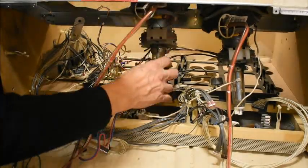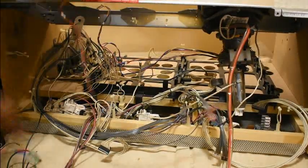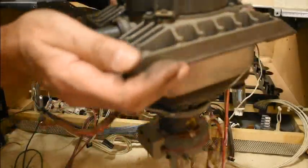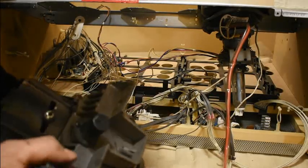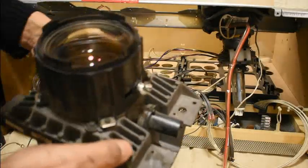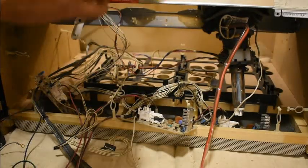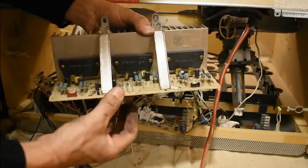The centre CRT is now freed up — that's the green CRT. There's a little expansion unit here to allow the cooling fluid to expand, which I tried to take apart and some of the liquid ran out. So this will need further dismantling. This board with large heatsinks appears to be amplifiers for part of the beam convergence — it could also be part of the scanning.